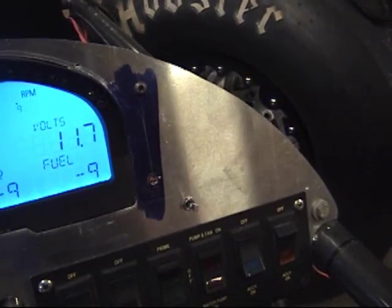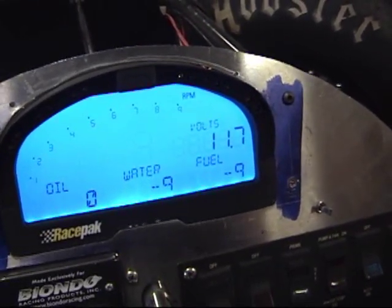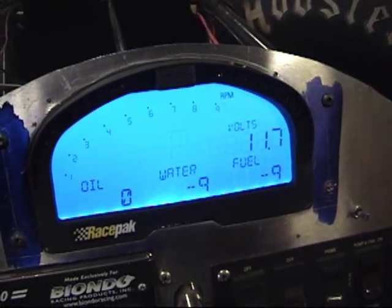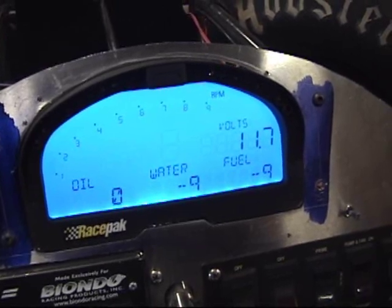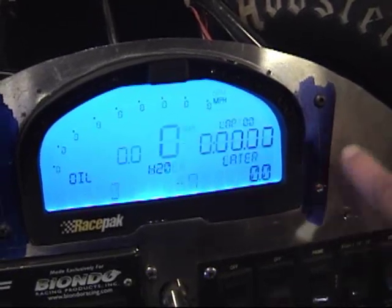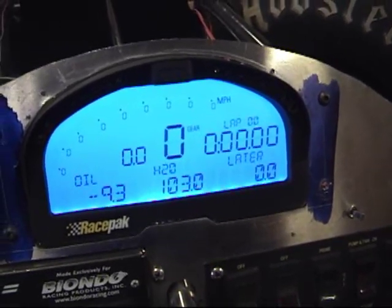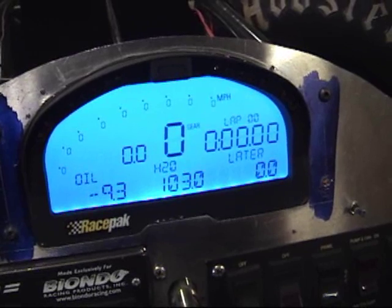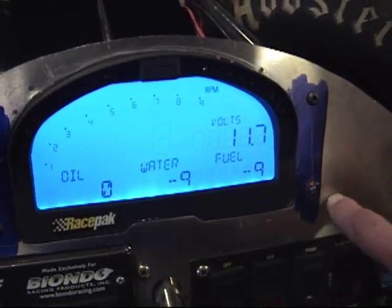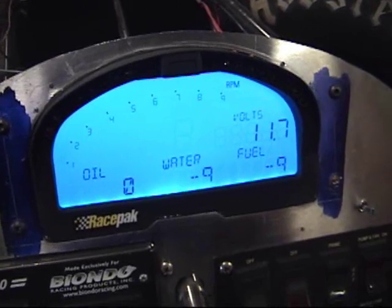The first thing I'll show is button two, which we'll toggle for our different screens. I have one screen programmed for the drag racing look and one screen still in a road race mode. This is screen one — I'll toggle the switch once and now I'm on screen two, which is a road race orientation. We're going to program screen two to have a drag race look to show you how that works. If I toggle again I go back to screen one, screen two, and so on, because out of the four possible screens I only have two programmed.